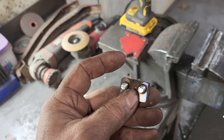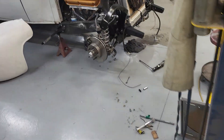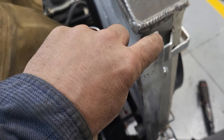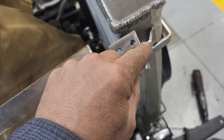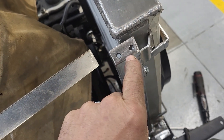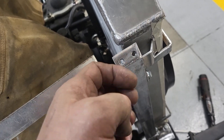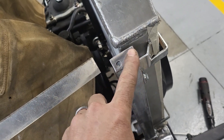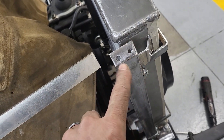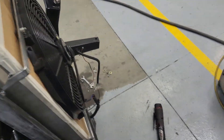I cut a bead in the middle — it is not perimeter-welded yet. When I put it in I put a chamfer on the c-channel all the way around so I have a V in there. Then I slowly and carefully weld it up being cognizant of which side I'm on. I stick the piece in with a weld magnet to hold it flush with the surface, tack it in four spots, finish-weld that side, then flip it over and weld the inside.